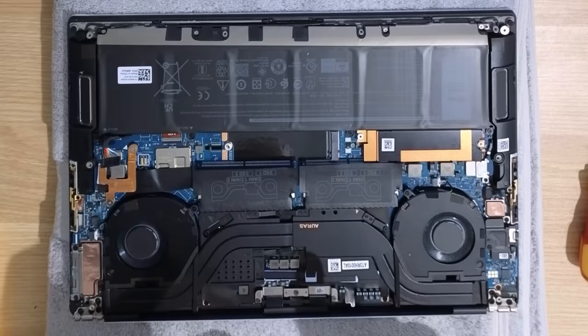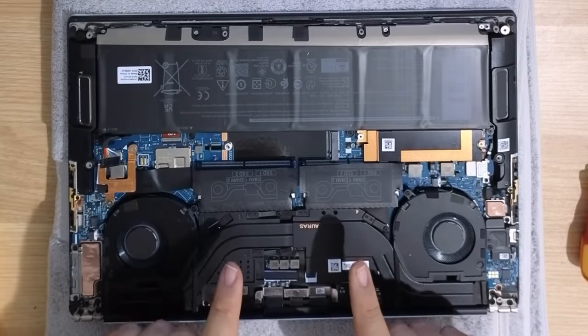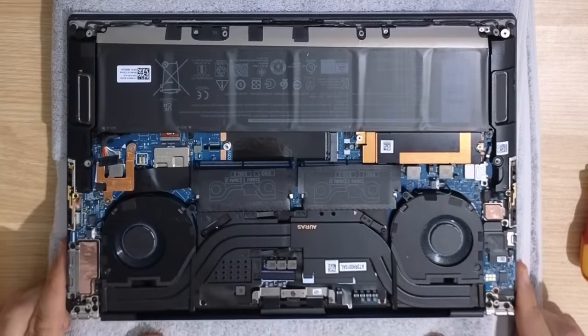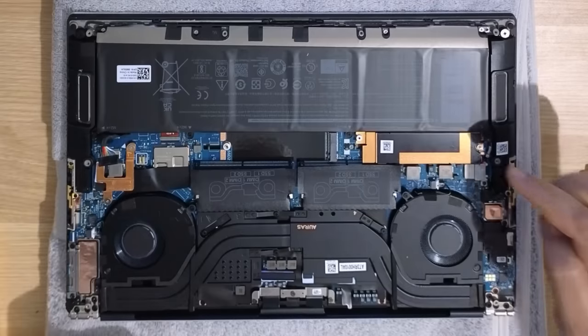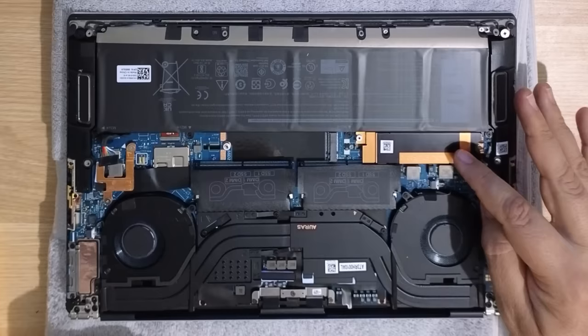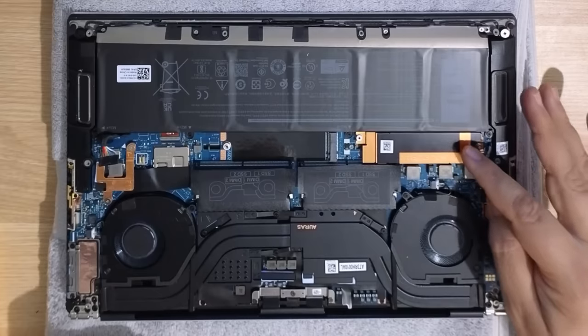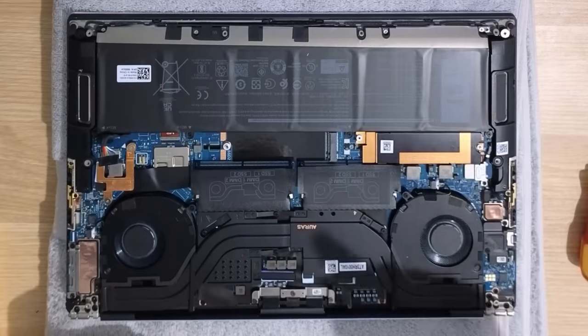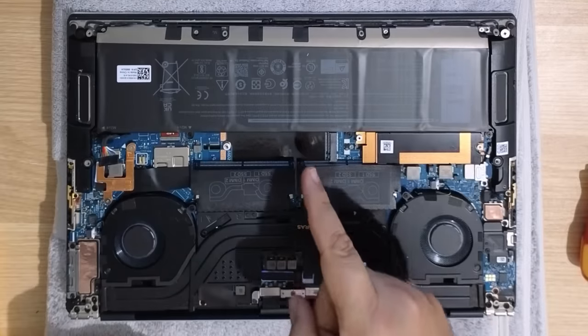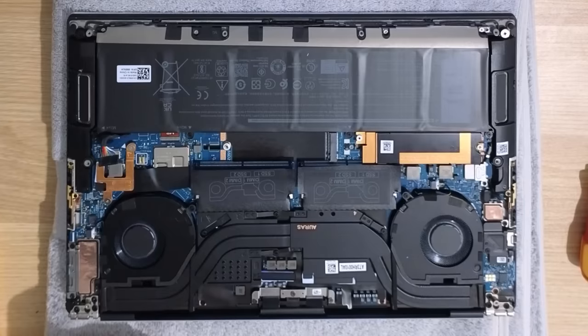It's important to note that the RAM that you need is DDR5. You can check the specifications with the Dell website. We're going to be upgrading the 512 gigabyte SSD that's here to a two terabyte model, and I actually have an extra stick of 250 gigabytes to pop into the second position here.